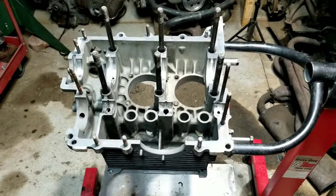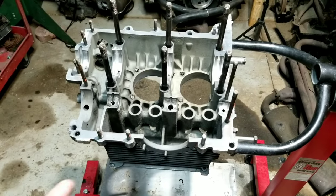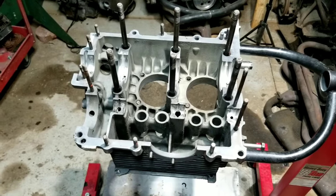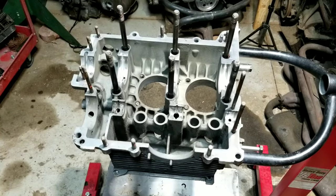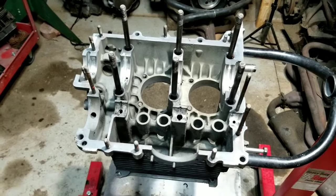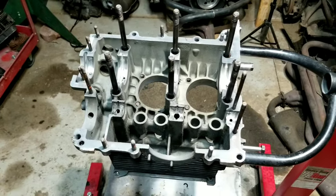So you could say, if you were going to do something like this yourself, you could go with, say, the Engle 100, or the W86. We really like the W86 cam, and you could add a ratio rockers to it as you decided to put more features on it. So let's say you decided to put dual port heads, or if you went with the 88 thick walls and then put the big valve heads for the 90.5s, that would go on something like this, but I don't know if I would do that with this case.